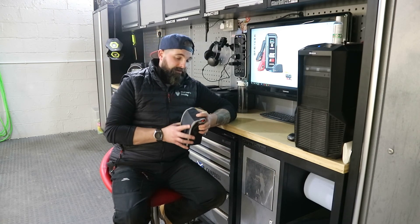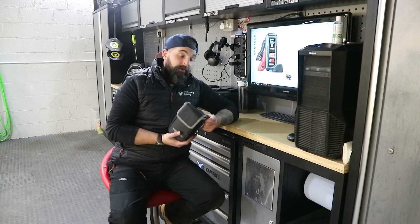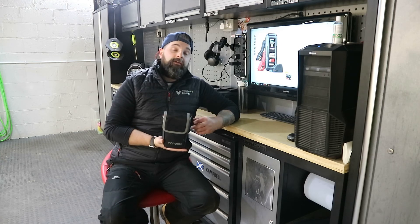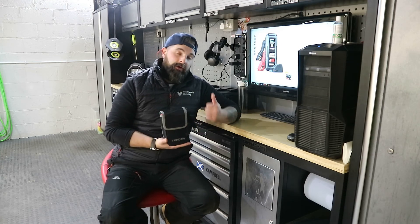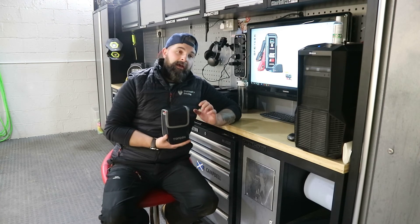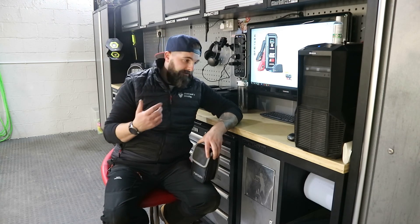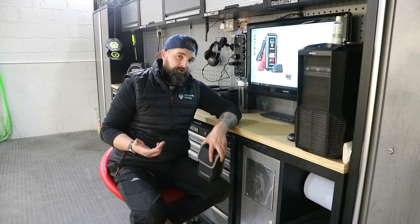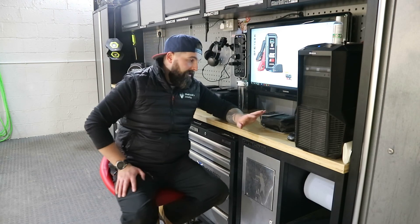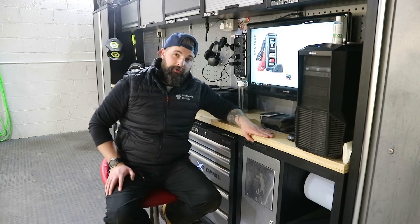This is quite a handy little thing. Very first time I've used it on that bike and it worked without a hiccup. Just make sure that you're using the correct points on the vehicle — make sure the negative is an actual negative terminal point and not just a bolt sticking out somewhere, because it basically won't jump start at that point. Hope you've enjoyed the video, please hit the subscribe button. Take care, thank you, goodbye.